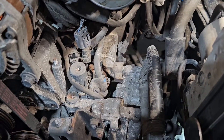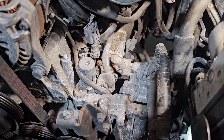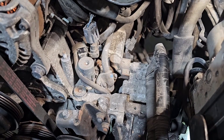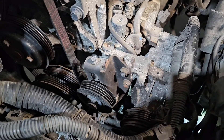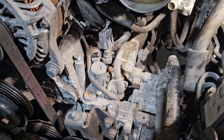I'm changing spark plugs at the same time. You can get those from underneath — take that through the wheel well or underneath. You can take that rock guard off under the engine; it makes it pretty easy.